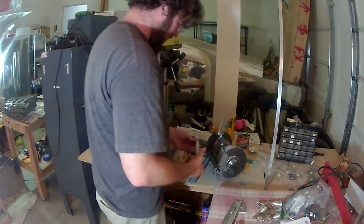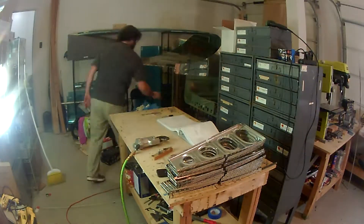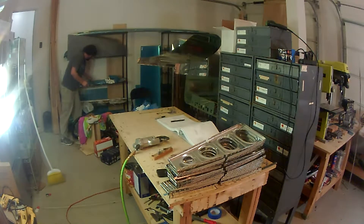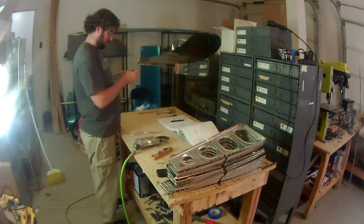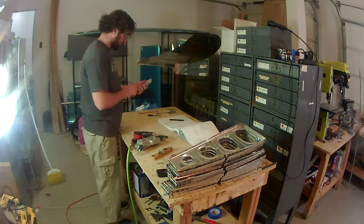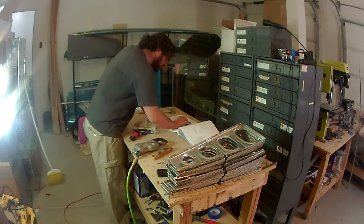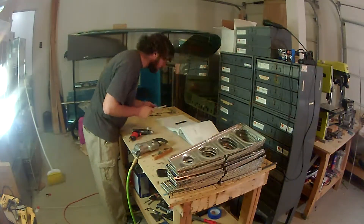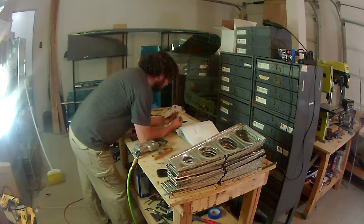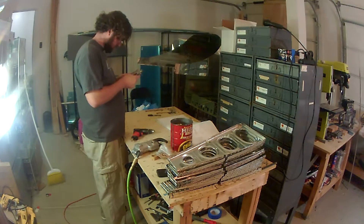I've been working a lot on the airplane at night. It's still warm here in Phoenix — typically about 105°F during the day — and working out of my garage means it's about 120 degrees in there. I've had the last few days off so I've been working throughout most of the nights on a night shift schedule. I've actually gotten the right wing ribs done and everything attached and riveted to the spar, which you'll see in the next couple of videos. I'm ready to start working on the rear spar with its doublers, and I'll probably start on that tonight.